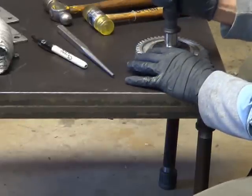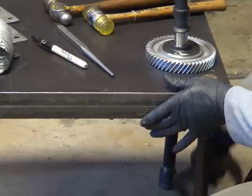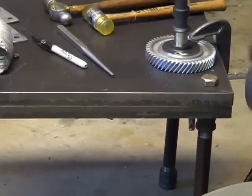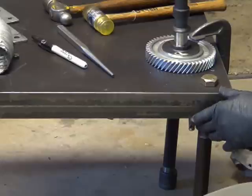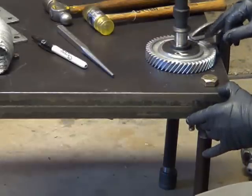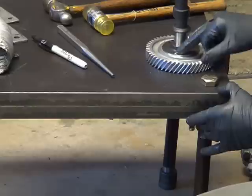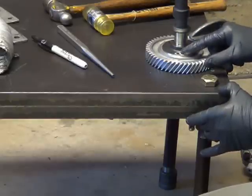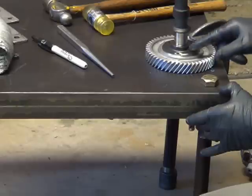It was a riveted cam gear. So what I did was, oh, here they are right here. I grabbed the C-clamps and tightened it to this top, and I got my side grinder out. Just freehand, nothing special. I lightly ground the ends of the rivets down to the camshaft, and I did score it in a couple places, one a little more than others, but I didn't want to take away the thickness of the metal because I'm going to have to thread that to attach the cam gear from the other cam onto this one.